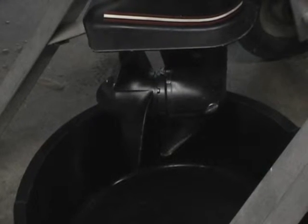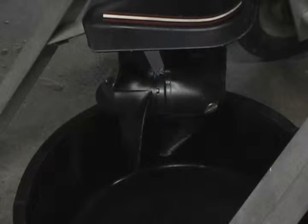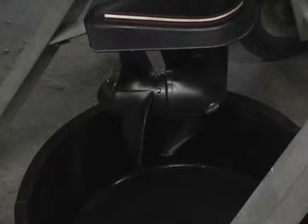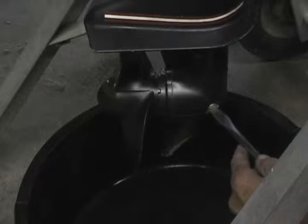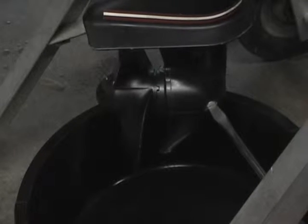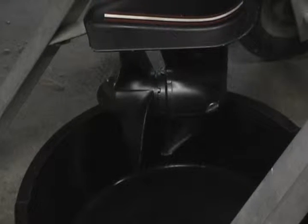It's hard to see because you can't see it from here. But right above it, the drain plug is here. Right above it, that's a vent. You drain it by opening up the bottom one and then opening up the top one and just let it run out. So let's see if we got any water. Well, it's tight. Let me fix that problem.